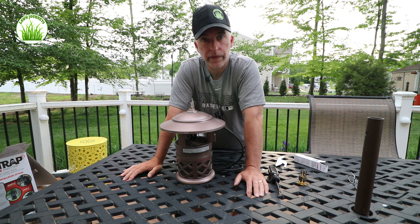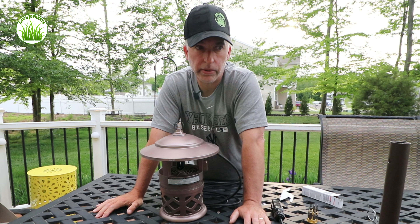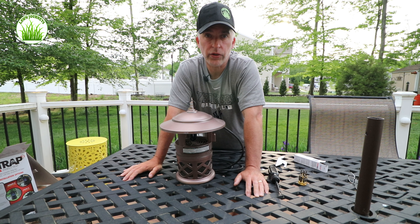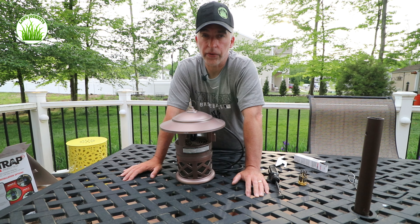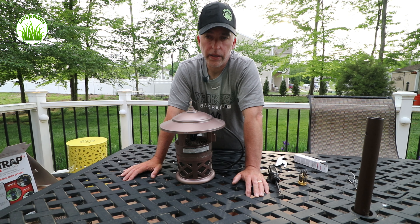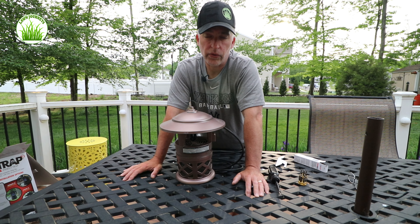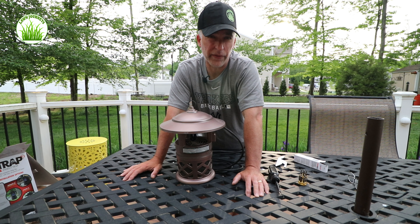The bulb replacement took all of three minutes — it's easy to knock out. Like I said, this Dynatrap model I've been running probably four years now. I run it 24/7, I just plug it in and let it go. The bulb is rated for four to six months of 24-hour operation, so in New Jersey if I start this up near the end of May it'll take me into the fall, past the height of mosquito season. It's a compact fluorescent light so it uses minimal wattage — the whole thing is maybe five or seven watts, so you're talking cents per day to run.